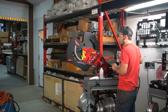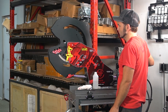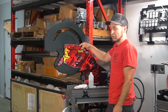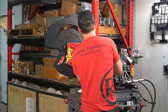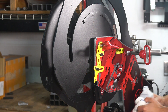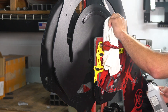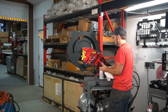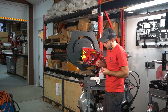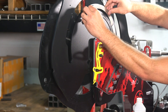Now I'm going to back the hydraulics so I can get to the other side easily. The edge of it's just past this part in the frame right here, so I'm actually going to lift it up a little further and use the lock pin — it's going to give me a better view of that area. Again, we'll do a little wipe with IPA. Definitely wait until that dries; it dries pretty fast. Then I'm going to peel off just a little bit and get it lined up.